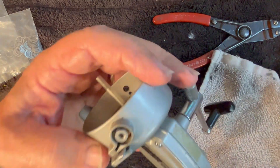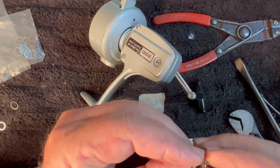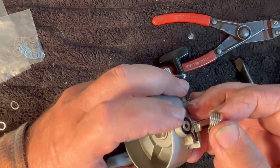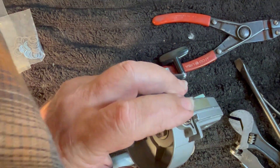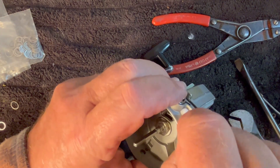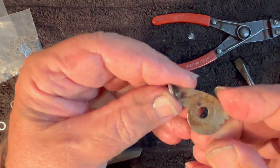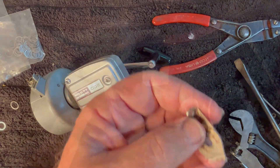I'm going to do that with just a small screwdriver and a rag. I'm going to spray a little WD-40 in there to help dissolve any corrosion that might be in there. It won't take out all the corrosion but it will help. Take that screwdriver and just kind of run it around in that slot to try to get any debris out. Let's take a look at our spring — spring is in really good shape. So we're going to set it back in here. The tag end right there goes into this slot over here. I'm going to take this over to the bench grinder as well and clean it up. That's two parts I'm going to put on the bench grinder to clean corrosion off of.